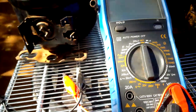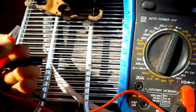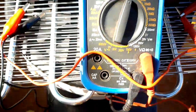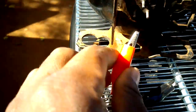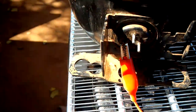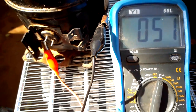This is how you test if the compressor is grounded. Put your multimeter in diode mode, then put one clip on one of the terminals, and the other clip on the body of the compressor. You can see we're getting 50 ohms right there, which shows that this compressor is bad.